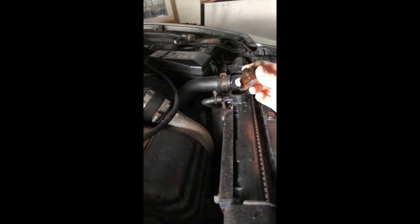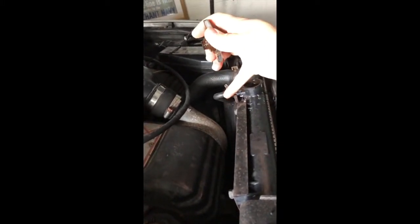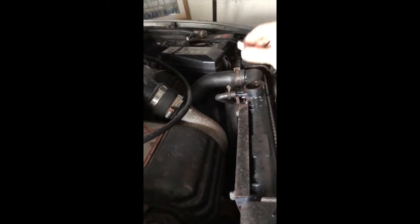it's pretty crap. That's the water. Okay, I don't think there's any antifreeze. I think he filled it with tap water. Maybe you can't see from this angle, but when we remove it, the mushroom filter is just a filter, but without the filter mesh. So it's the casing only. So we'll have to get a new filter element on there.